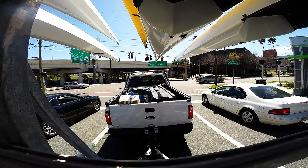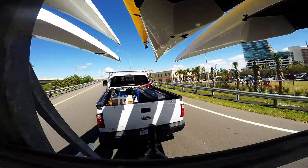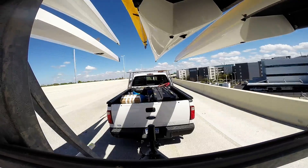Making a left turn here — same exact thing: truck goes on the outside of the turn, trailer's going to come inside, just plan for it. Make sure you've got plenty of room, go nice and slow, then merge up to speed with all the other traffic and get on the highway.